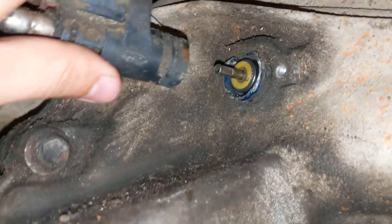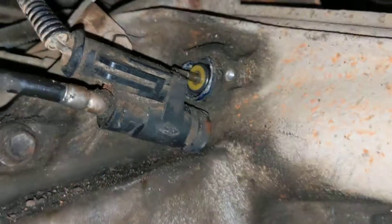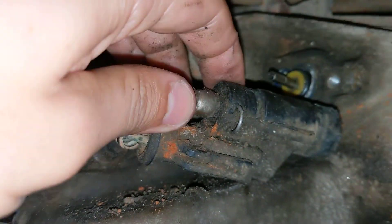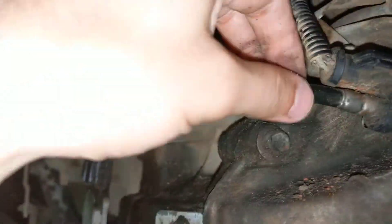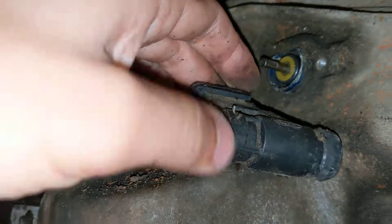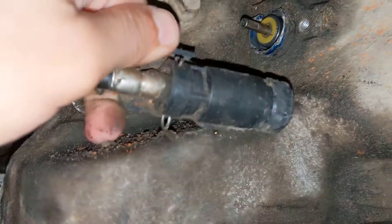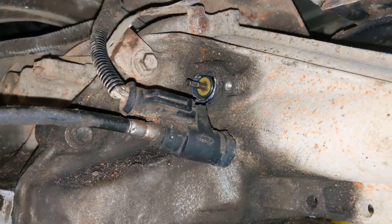This is supposed to be attached — this is one piece, it isn't a two-part piece. So I gotta put this retaining clip back in and I'll order a new one of these. Just gotta pull this pin out right here and I'll be able to disconnect it from the speedo cable, then just clip this back. This is original, never replaced, so we'll see about getting this part — shouldn't be more than 10 bucks. Hopefully get third, fourth gear, and overdrive all back.